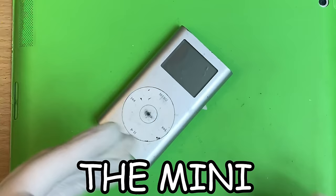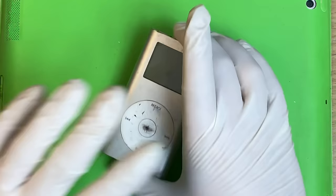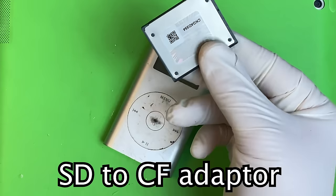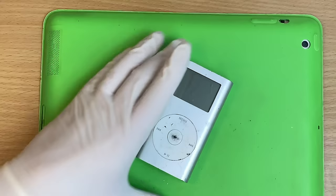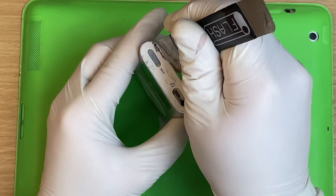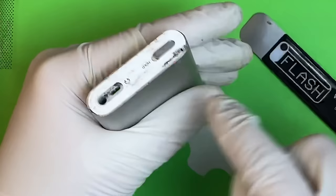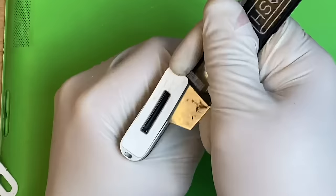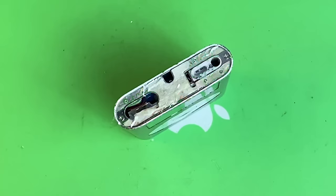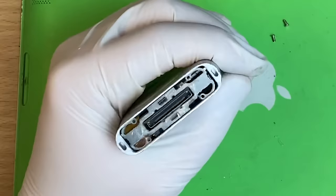While it's not an iPod classic, the iPod Mini deserves a look in because these are awesome to mod. This is a very sad one — hopefully like how you'd find it. These are so easy to mod: to flash mod it, you just need this adapter — it goes straight in. We're going to get the top and bottom plastic off. If you care about yours, try to use plastic tools. The plastic is glued down, so enjoy that. If you scratch it, it's really bright and silver underneath — so if you've got a pink one, it won't look very good.